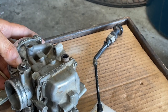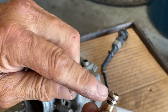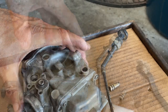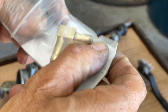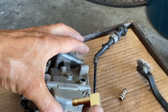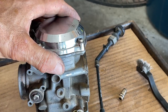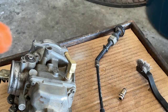I want to put this inlet in. I'll get a little wire brush and clean this up. This is a popular problem — it's a vinyl elbow that comes on this; they fail, they'll leak gas, they'll cause all sorts of havoc. A new inlet on eBay is 15 bucks — you can't go wrong. It's a nice brass piece; be careful with it. This came from K&L on eBay. You've got to realize the carburetor sits like this and the fuel inlet usually sits at a little angle.